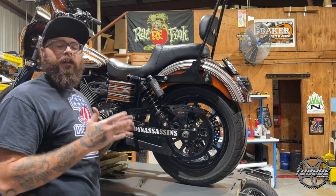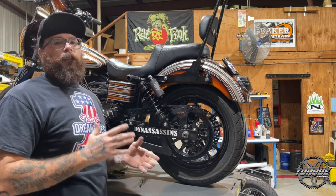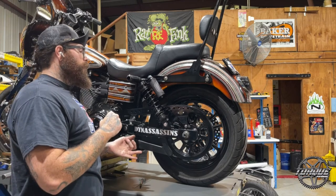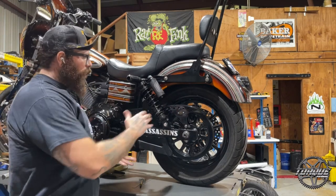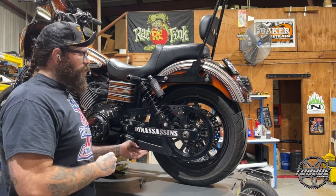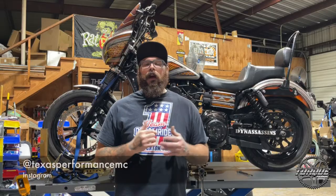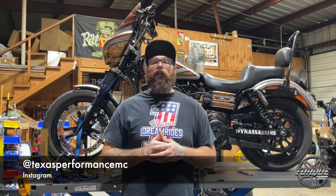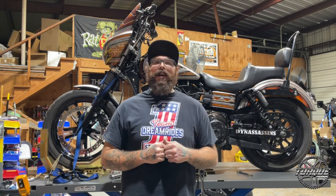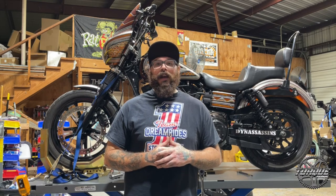Harley spends a lot of time doing research and development to set it to that. We do recommend checking this belt tension about every 5,000 miles — we like to do it at every full service, which we do every 5,000 miles here. Obviously anytime you change a tire or brake rotors, anytime you have this axle loose, we like to check this belt tension or chain tension and adjust it at that point. Thanks for watching this week's tech tip. Don't forget to follow us on Instagram at texasperformancemc, our website is texasperformancemc.com, and follow Torque Mag USA. We'll see you next week at nine on Torque Television.